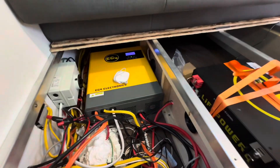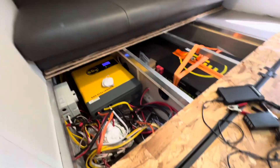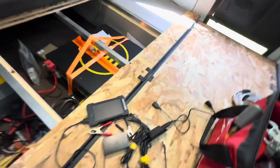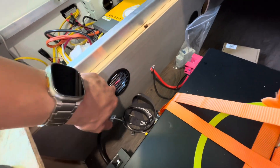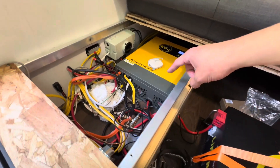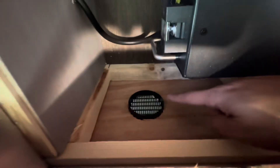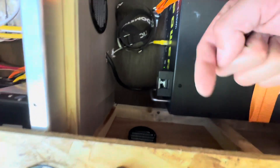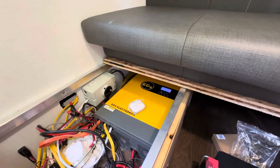The main issue I've had so far with this inverter is that it gets very hot. When I have this bed closed, it gets so hot it leaks to the other side and shuts down the inverter, so it doesn't power the air conditioner anymore — it's an overheat protection. So I drilled these 3-inch holes right here and put soffits in for now. I'm going to add two 12-volt fans up there where the intake is, and this is the exit. I've got some dryer tubing to route the heat from there into a hole I drilled as well, which pulls all the heat out into the cab so the air conditioner can cool. There's another hole over here — I'm going to route more tubing to get cold air to that inverter so it doesn't overheat, and I highly recommend doing that.